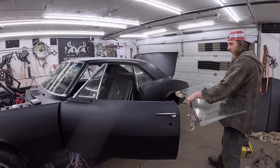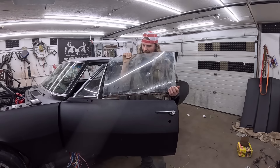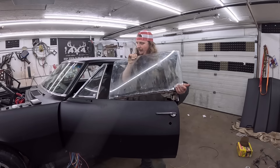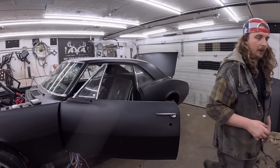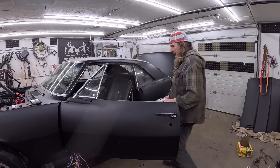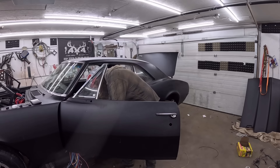I got this window — took the track, knocked it in there. Now I'm all covered in grease, so it should be fun to try and get this thing in. Guys on the internet kind of folded it down — it just doesn't seem like it wants to fit. There's a stop on it so on a hardtop the glass will essentially roll all the way out, which you don't want. It's the wrong size, so it has a little stop so it can only go so far up and down.